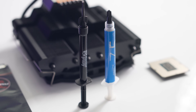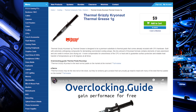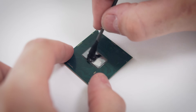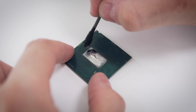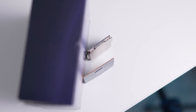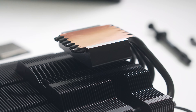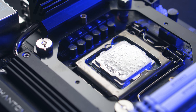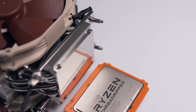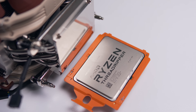Keep in mind we're using a standard paste here for comparison — you'd still likely see a slight decrease with something more premium like Thermal Grizzly's Kryonaut, which has a very high thermal conductivity for a paste at 12.5 watts per meter kelvin. With liquid metal previously, we've seen a significant difference when delidding 7th and 8th gen Intel CPUs because the thermal material needs to conduct heat across a rather large gap between the CPU die contact and the heat spreader. When it comes to CPU coolers though, don't expect a large reduction, especially with a mainstream desktop CPU like the 8700K. For Skylake-X or Threadripper CPUs there may be additional benefit using liquid metal between the heat spreader and the CPU cooler — something I plan to test in the future.